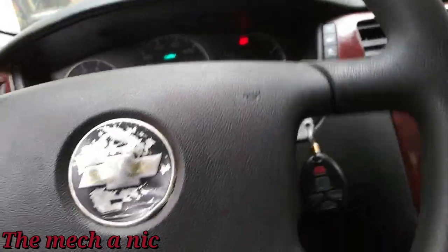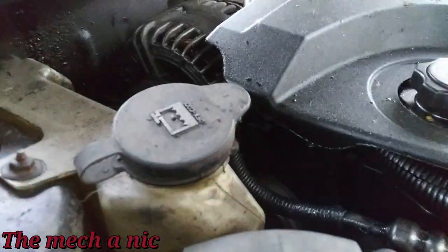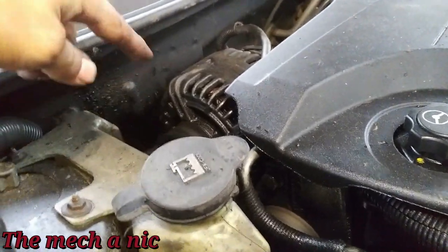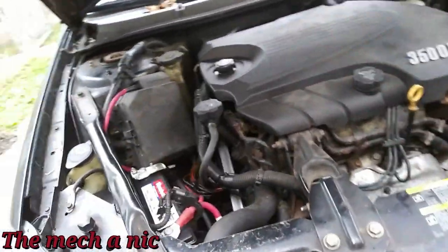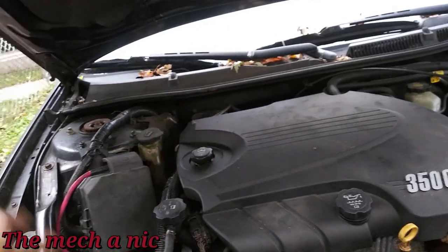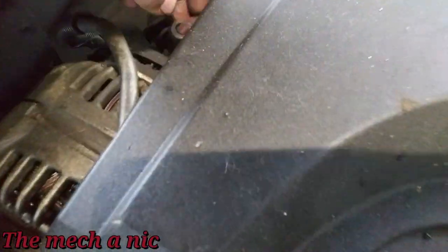Rock hard to turn. The serpentine belt is on, the alternator is spinning, but look at the alternator — it's completely covered in whatever that is, antifreeze or oil. I'm going to go ahead and check normal alternator things to see if we're charging; if not, we need the alternator too. I checked for power right back where it connects to the alternator and we have absolutely nothing.